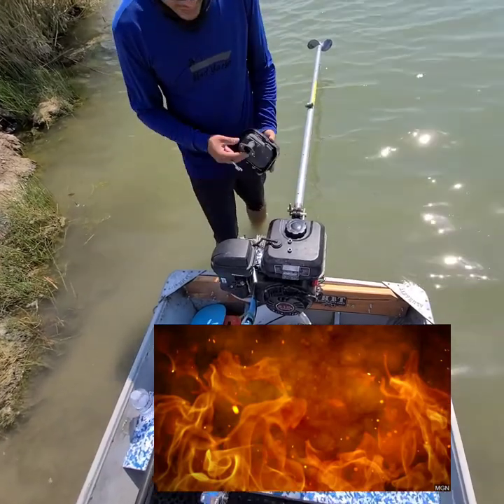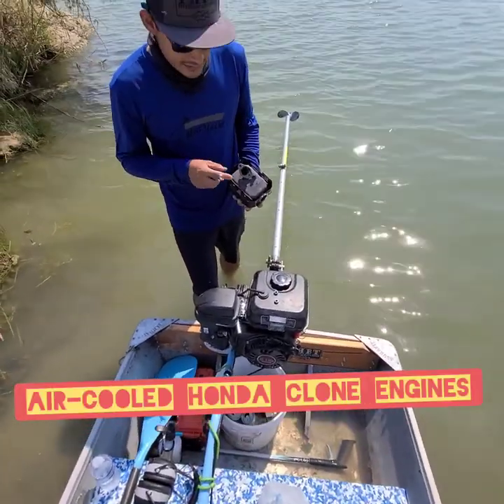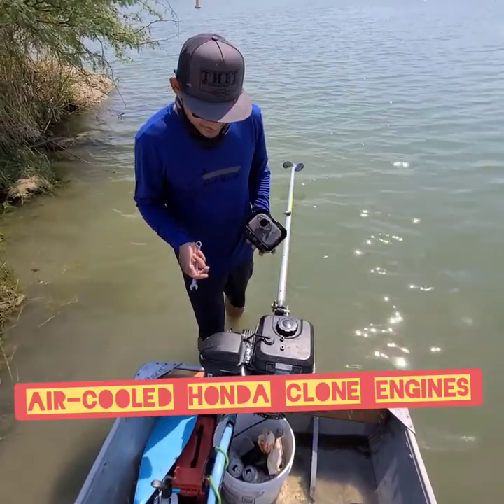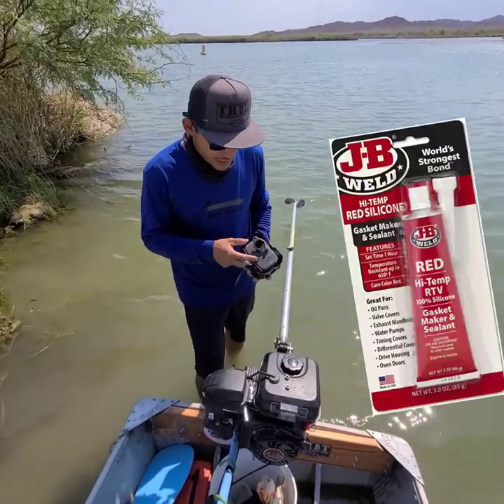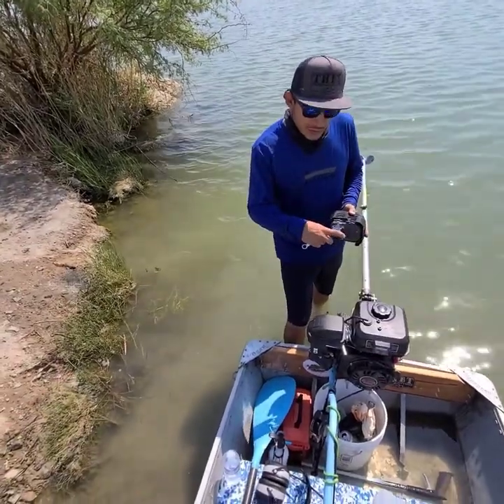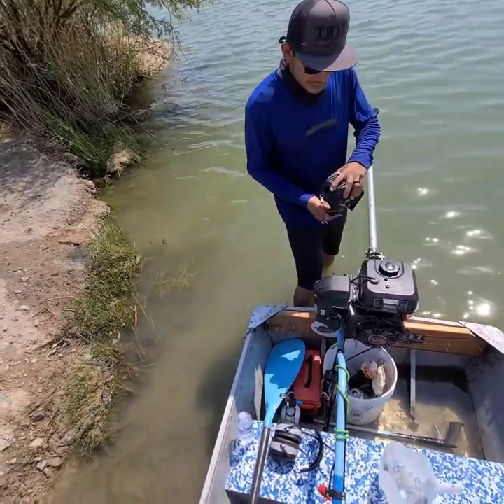So far the runs have been good. I do see that there's an exhaust leak — it could be because the gasket that I'm reusing just doesn't fit flush, so I might have to figure out a way to redo that. There are only two 13mm bolts holding it down, so it's easy to unbolt and readjust.